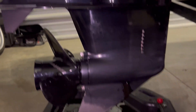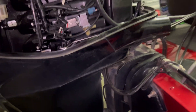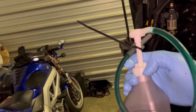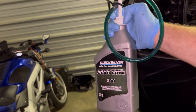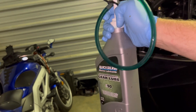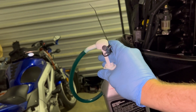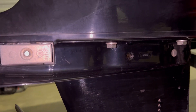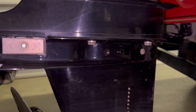Now what we're going to do is take our gear lube — and you've got to have one of these pumps. I bought it with a kit last year and this is my old gear lube that I used last year. I still haven't used all of it so I'm going to use the rest of it on this change. Basically you take this, screw this little end onto the bottom down here, and then you're going to pump it until it starts coming out the top — and that's when you know you're full.